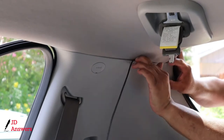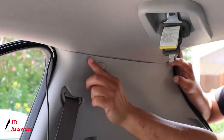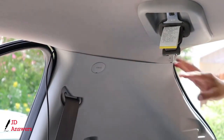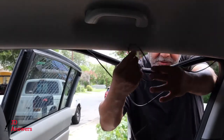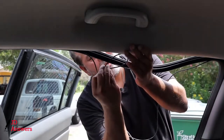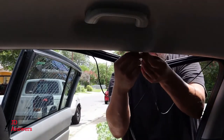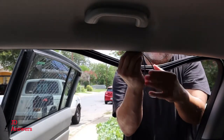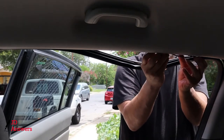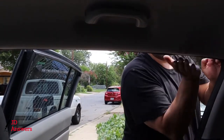I'm going to stop here because now we want the slack in this area. Let's work on the other back side. I'm in the back — I'm going to work my way to the front. Simply using my hands, I'm just guiding it in. Now I can start finishing the back — I have all this slack and I'm just going to push it into this area right here until there's no more slack. Then all you have to do now is put your weatherstrip back in. The rear view camera is installed — now let's work on the front.